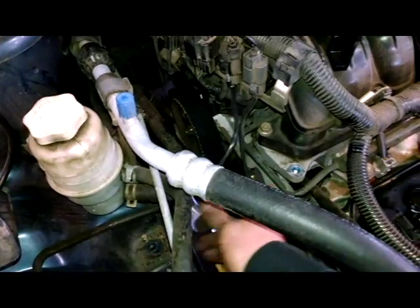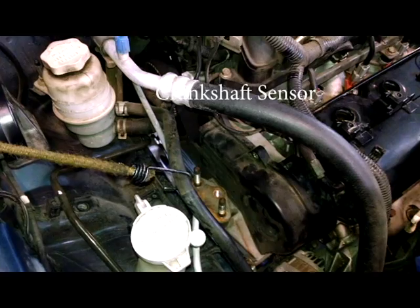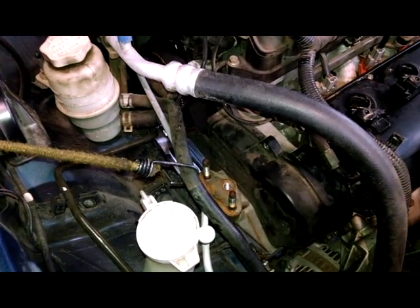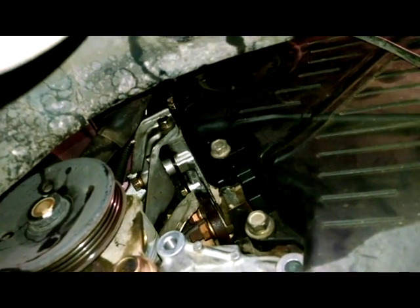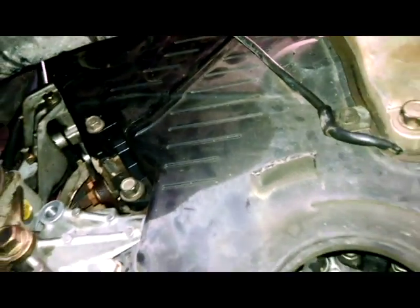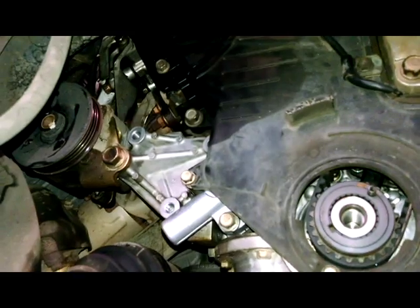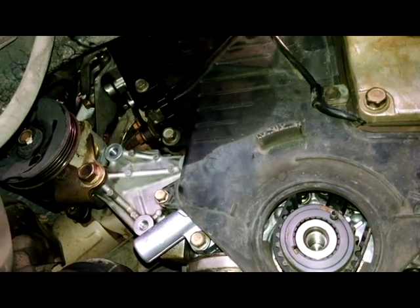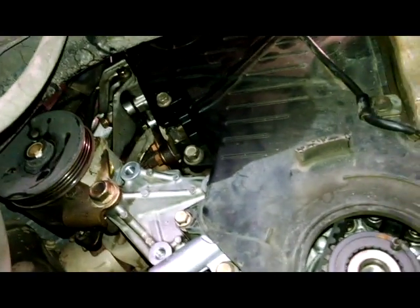You watch out for your wire for your crankshaft pulley, and then put the bolts back in. Back down here to install that 12mm bolt. I would suggest you install everything loosely before you tighten any bolts up. Make sure your tangs are interlocked properly before tightening anything down, and then everything's in place, all the bolts are started. Go ahead and tighten them down. Again, probably just looking at about 80 inch-pounds, 70 inch-pounds, pretty light for the 10mm bolts and 12mm bolts.